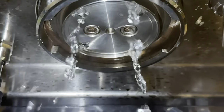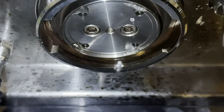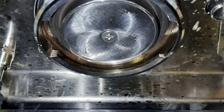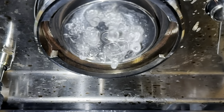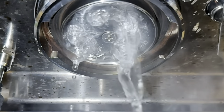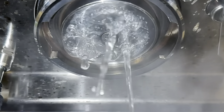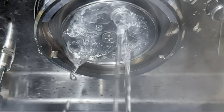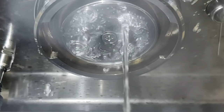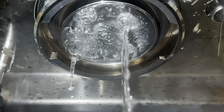I'm just running the water head here. If water is coming out uneven on one side, there's not really anything you can do once it hits the shower screen. I saw it in all my shots — it came out uneven. Even with the shower screen on, it still comes out uneven, which means water going into the puck is uneven. It doesn't matter once the puck is fully pressurized, but when the puck is in that transient state of not being fully pressurized, the unevenness shows and causes a big channel to the right or left side.